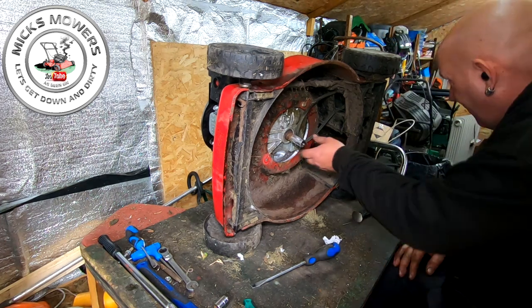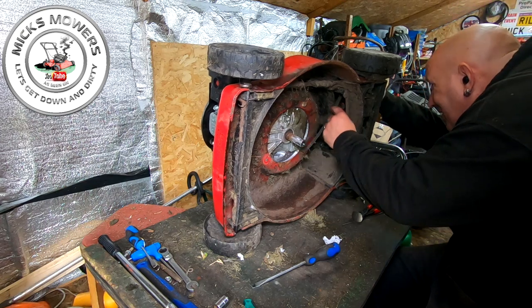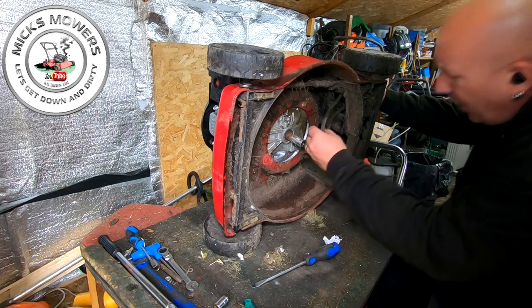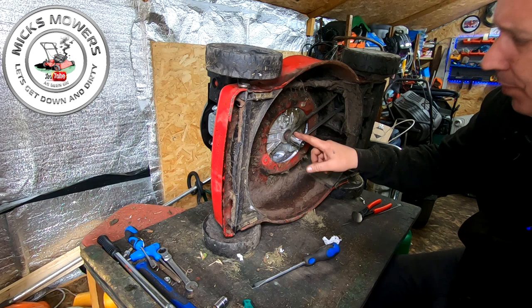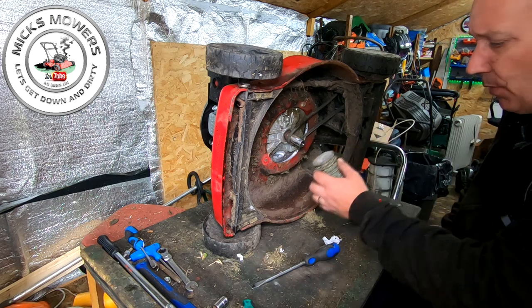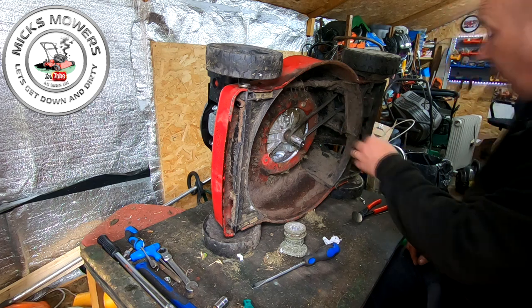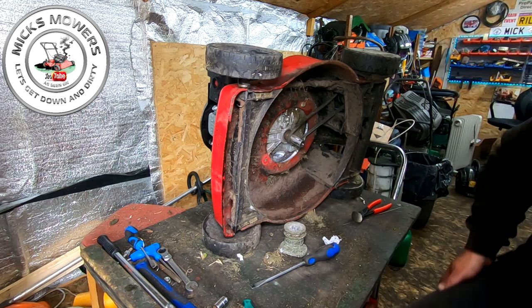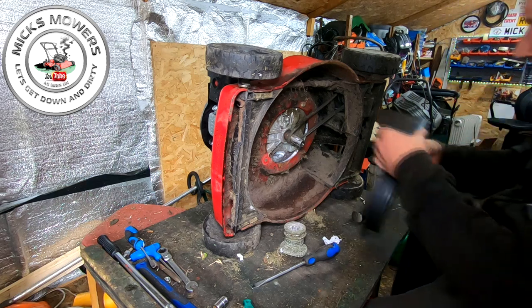I've then got to refit this belt on, make sure it's on the back pulley already, which it is. Yeah, it is. That's got to come up and over the shaft. And then I've got to refit the boss back on, this one here. Make sure you don't forget your keyway. And then refit the belt guard, which had come off with the belt. I've got my new one on. Here it is. There's my new belt guard, a bit squished, but it'll be alright.